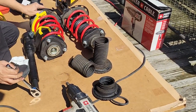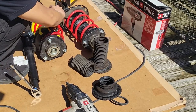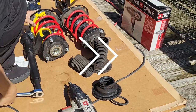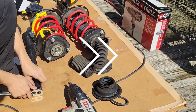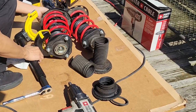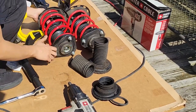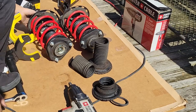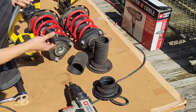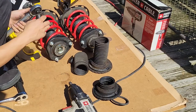While decompressing, make sure the bottom rubber isolator and the spring stay properly seated. Let's get this off of here, and then I'll tighten the nut down to at least 20 foot-pounds before I put the struts back in storage. Whenever I decide to reinstall them on the car and they have some weight on them, I'll need to tighten those nuts down to 35 foot-pounds.